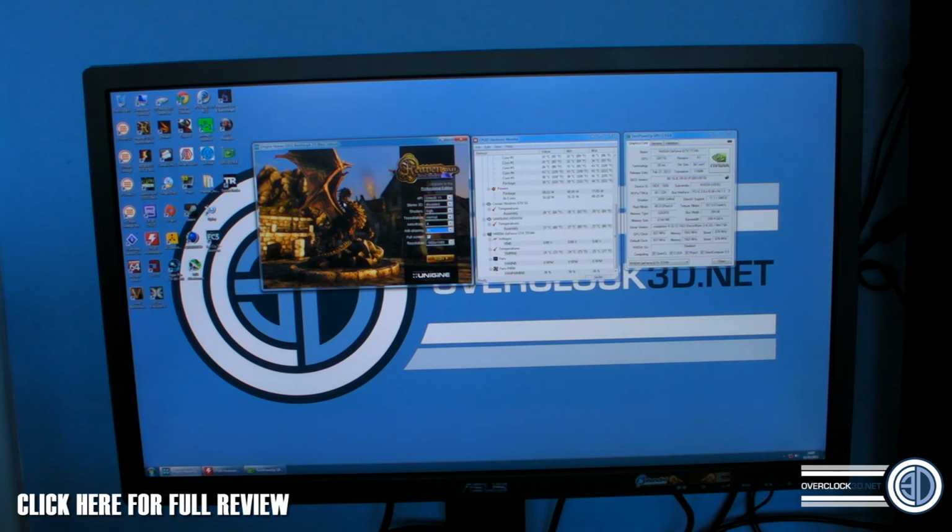The reason why we're using Heaven and not Valley is that Heaven is what we've been using for our GPU temperature testing for ages, pretty much since it came out, in fact, and we run it for 30 minutes, and we don't want to switch over to Valley in case the temperatures do start to increase. If you have a look at hardware monitor here, the current temperature at the moment is 24, minimum is 24, maximum is 25, and over here is just GPU-Z to validate the stock clocks.